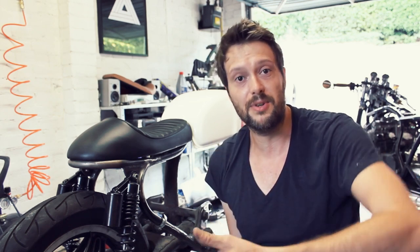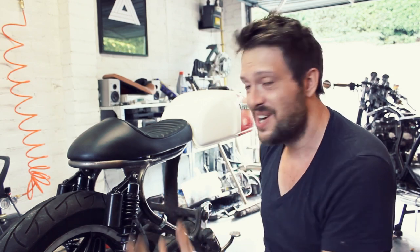I might put the engine back in and then measure everything around that. So far I'm so happy with the job that the fabricator has done. It goes to show sometimes that you have to put your trust in other people — you have to admit when you can't do things yourself. My welding is alright but it's nothing compared to someone that does it full-time, and it's not as safe. It takes years, it takes experience, mistakes, failures, all sorts to learn how to do a proper weld. The problem is if you haven't got that experience, you might weld the outside but you're not actually fusing the inside — and that's the important bit where the two metals actually fuse together. With this it's superb. I have no complaints, I absolutely love it. It's seriously made my day, and no more CX500 horrible wave frame that I absolutely hate — it's beautiful.